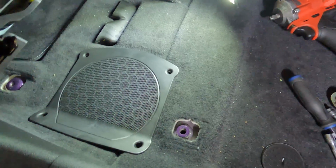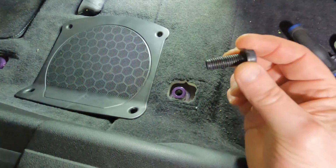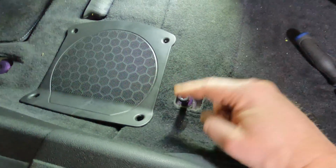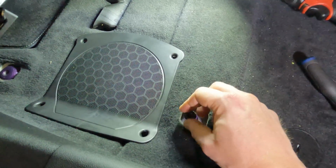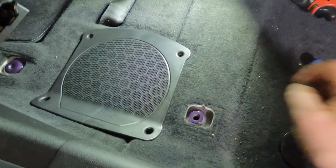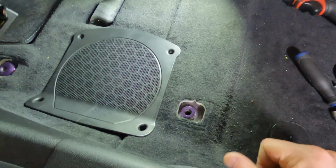which is really, really simple. And I'll probably say this a couple of times, but whenever I put these bolts back in, 1, I always make sure the threads are clean. 2, when I put them in, I always just hand thread them into place really gently all the way around first, before I torque them down and tighten them down, okay? So, just a couple of things to think about, but let's not jump ahead too much. Go ahead and get your cover re-secured, lay your seat back down into place, and then we'll put those bolts in and torque them down.